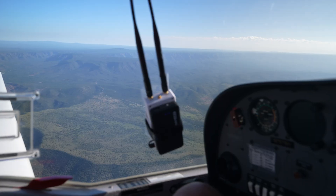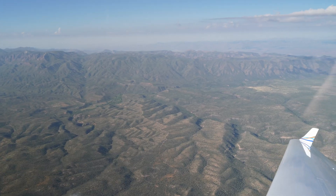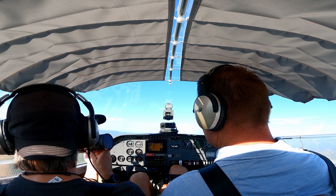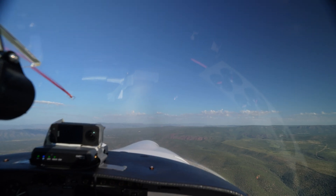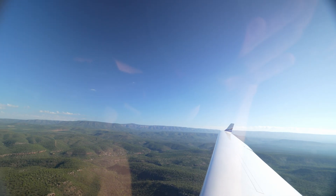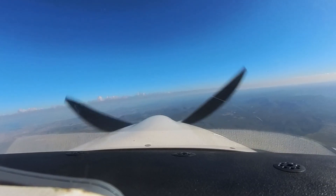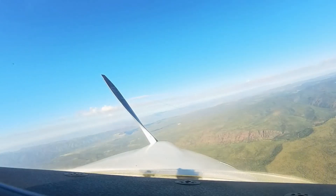This particular aircraft has the Rotax 914 turbo, which is 115 horsepower, and it can actually use regular automobile pump gas. The DA-20 comes with the Continental IO-240 at 125 horsepower, or is optioned with the 912 non-turbo version at 100 horsepower. The prop is in feather — wow, okay, so that's different.